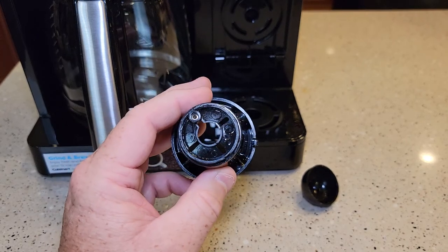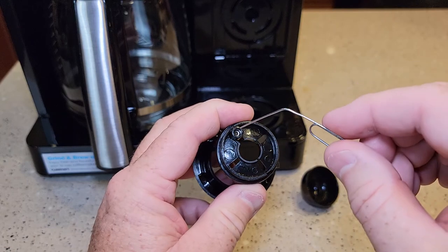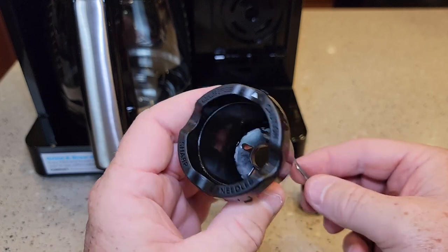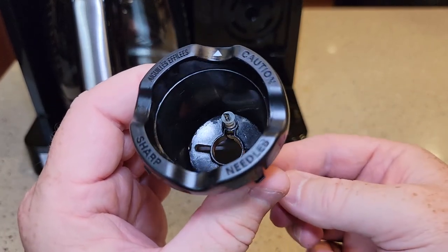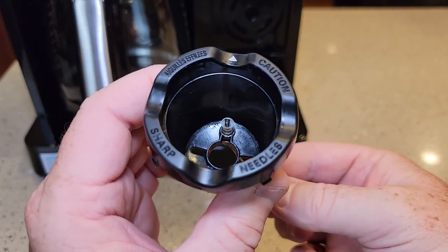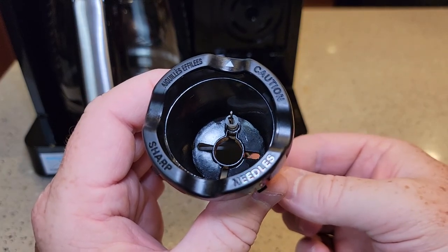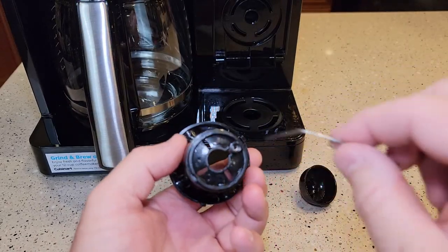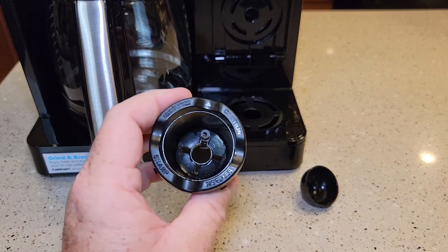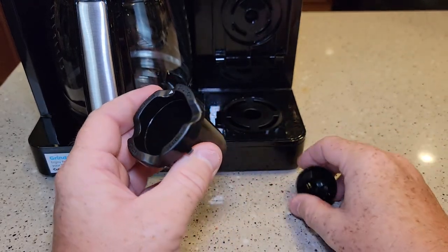Here's the bottom of that K-cup basket. Take this over to the sink and while you've got your paper clip, you can poke it in the hole. This comes straight up and out. This is not like a Keurig — a Keurig will not go all the way through — this one actually lets you go all the way through. Take it over the sink and just flush it out, run a bunch of water through here, take a brush and clean inside there. That gets really dirty. You can use rinse pods — they help clean the oils out of this area.